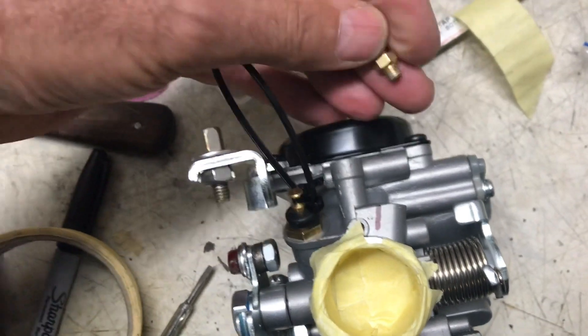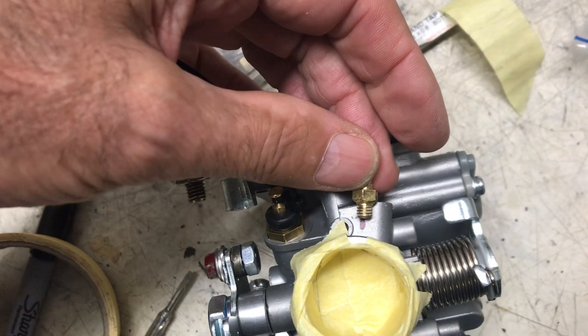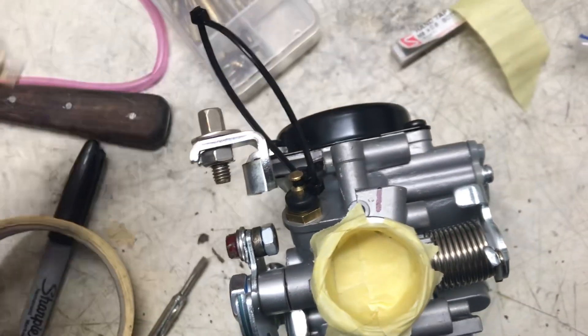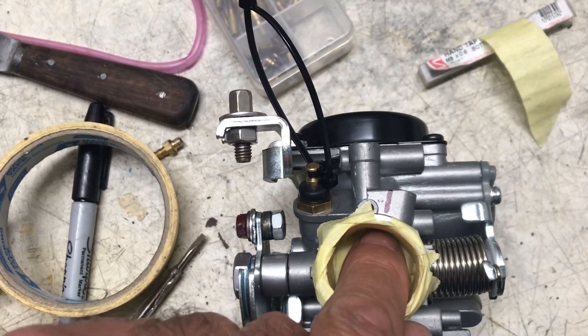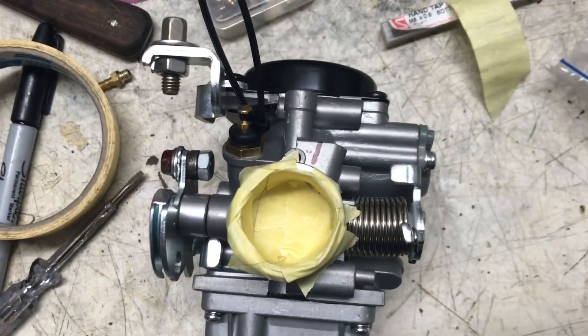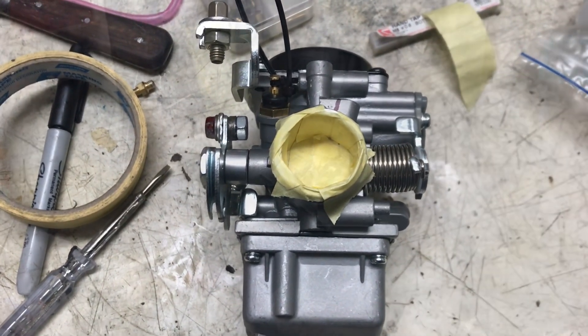What I'm going to do is have a go at this bypass again. I'm going to put this little nipple in there to bypass the blower for idle speed. The problem is there's one jet hole right there and one vacuum hole right there, and I've got to get it just in the middle. I can't be bothered to pull the whole carb apart so I've just done it like surgery — I'll drill it, tap it, and we'll have a look.